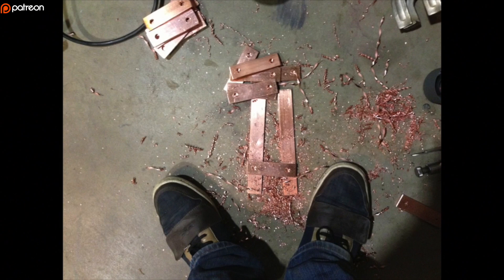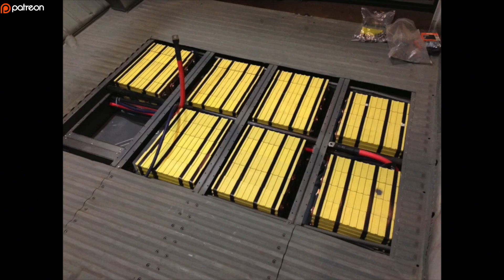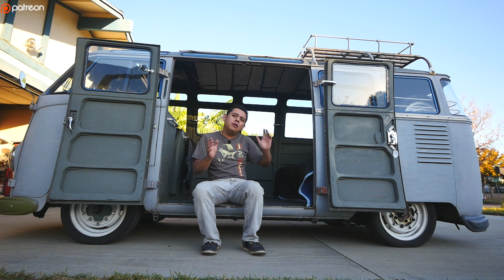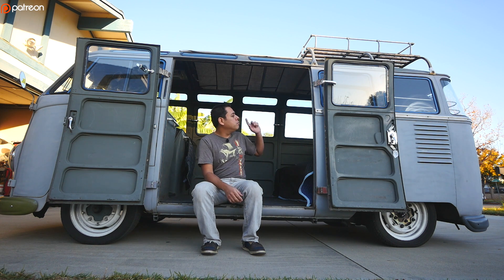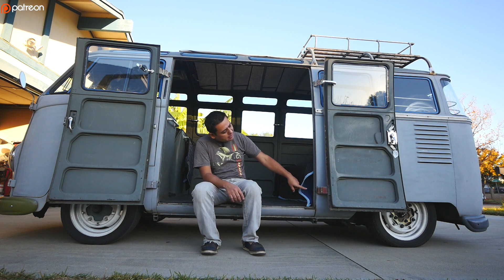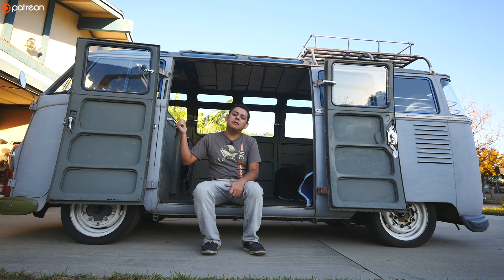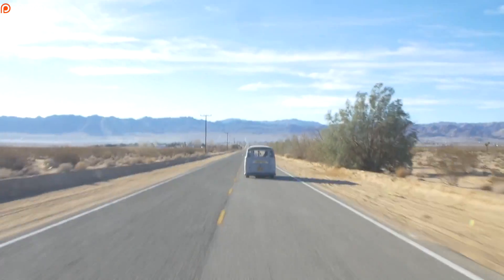It will allow me to put more stuff in here when we're traveling with less chance of getting a tire blowout, because I'm pretty much maxing out these little wheels. That's option number one. The other option is to forget all that work of taking out the lithium iron phosphate and rewiring all the new modules, because it would require some structural work — cutting and welding and stuff. Just take the extra six modules, add them to the eight modules that I have, put those in a trailer, and figure out how to connect that trailer to the back. That would remove about 350 pounds off of the back axle. The idea is to have a trailer that you keep in your garage most of the year, serving as your battery — your power wall — and power your house with that battery. Essentially that is your house battery that you can use whenever you want to go on a long range trip.